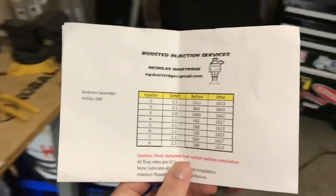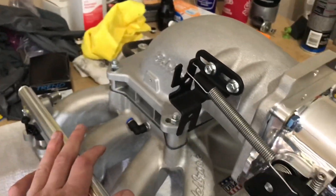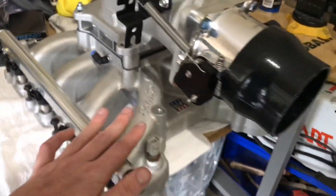I let Sergio borrow these things and I think maybe he had a little bit of trash in his fuel system, and I could have had some trash in my fuel system last year and didn't know it. So these things were clogged up pretty bad — it was definitely a good thing that I sent these off and got them cleaned, because that could have been a big issue with the new engine. Don't want to have that going on with a brand new expensive engine. Make sure you have your injectors flowed and cleaned, especially if you suspect there's been some trash in your fuel system.